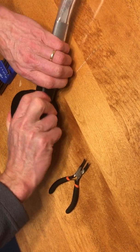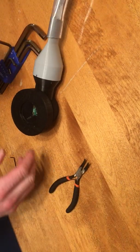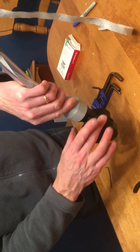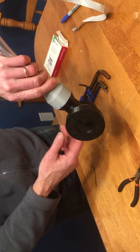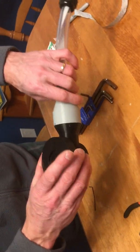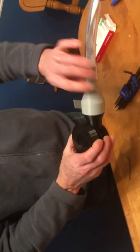And ordinarily at this stage you'd probably want to get a bucket of water deep enough to dunk it, and make sure that it doesn't bubble like crazy when you dunk it in. 1 or 2 bubbles from a little air pocket or a bit of dirt or something on the side is okay, but if it continues to bubble, that means you probably didn't get the window on well, and there's a bit of an air gap there. Okay, so that's pretty much it.